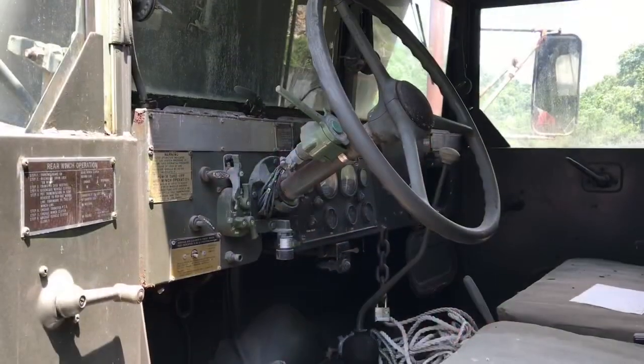I don't know if it's 6-year-old air from where we had it fired up the last time, or just from heating and cooling of the air tanks and truck and everything generating a little bit of pressure there, but who cares? It blew a little air out and the condensation came with it. So we got them ready to rock, and we're gonna go ahead and put the batteries in, keep the fuel turned off, crank it over a little bit, see if we can get some oil pressure circulating, and get it ready to try to touch this thing off.